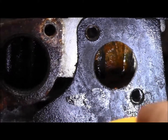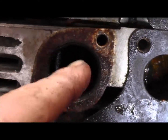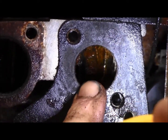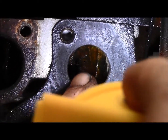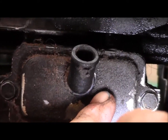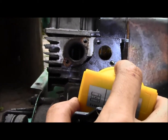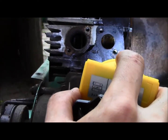We're looking at the intake from the carburetor and the compression stroke. That valve is free, but this one has a lot more rust and it's not free. I'm going to use my funnel and let some evap-o-rust sit in there. Looking down, I had this off too — I can see the compression stroke coming up but not the intake. It's coming up a little bit but not enough to engage the rest of the valve to lift it. I'm going to have to try to take care of that rust. Water is not your friend when it comes to engines, especially having them outside.